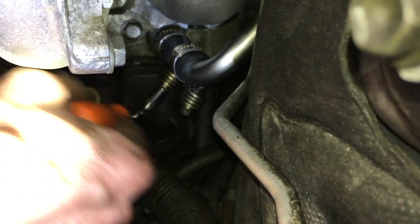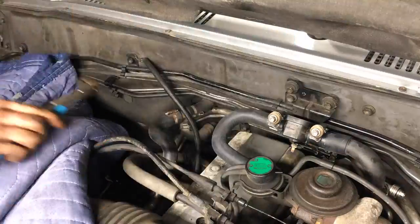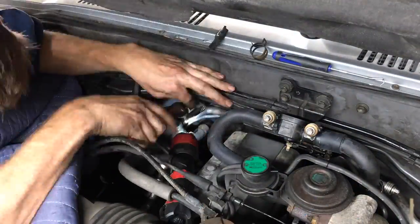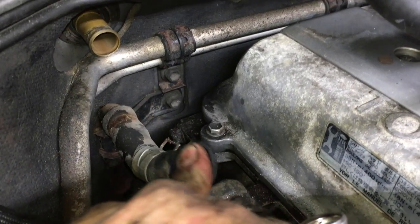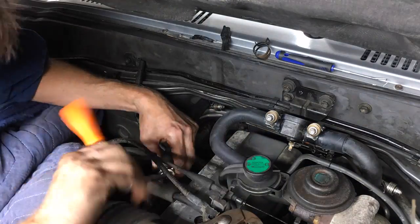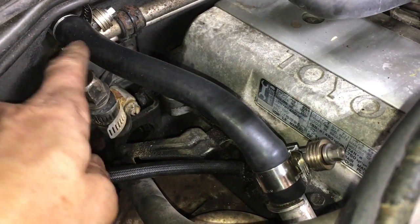And definitely can't forget about these on the pesky heater hose. And reattach the transmission dipstick tube to the intake. Now I'm removing the hoses on the return side. Just like before, they're fused to the brass tee fitting and the heater core pipe after 28 years. I had to end up cutting them with the exacto blade as well. The heater core is on top, and this goes to the rear heater which I'll be blocking off. Those two teed into the return pipe with the brass tee fitting. This is where the universal 5/8-inch hose will be used. I cut a piece about 9 inches long and went from the heater core to the return pipe, then tightened both ends with constant torque clamps. And I stuck a wheel bolt in the hose for the rear heater core, just like I did on the other side.